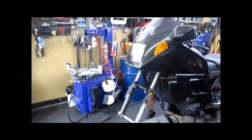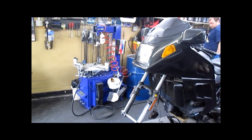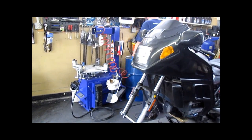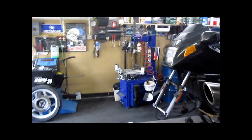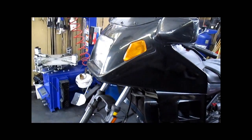If you hammered the races in properly and you are able to get the proper adjustment during this assembly, then at 600 miles later, you may not have to adjust them at all, but you should still check them. As I said, if they're loose, you mess up the bearings and you're doing this job all over again. Going up.